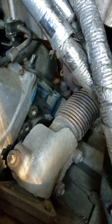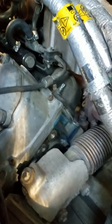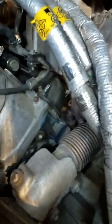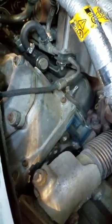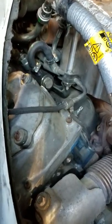That's our issue. You could also have a low-side problem from the tank up, and we'll get into that in the next video. I wanted to show how I found this so the guy can drive the truck — it doesn't smoke, it just had high balance rates on number seven. I changed it with a factory injector. If capping a line doesn't bring back pressure to 26,000, put the line back on, move to the next injector down. I've used balance rates to find it every time.